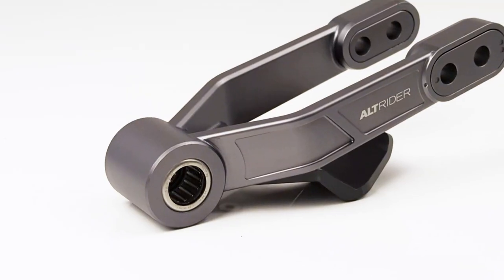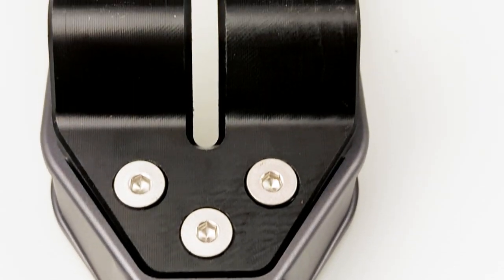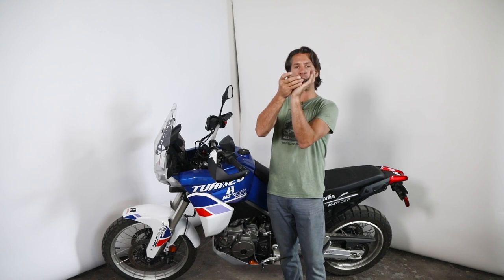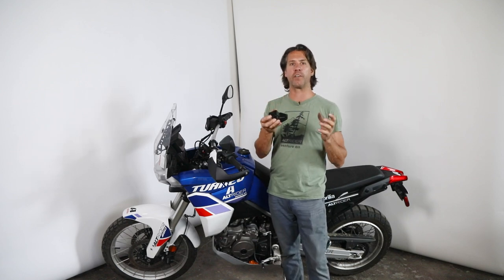The design is a solid piece of billet aluminum and has an integrated UHMW linkage guard that is lubricious — it's a very slippery plastic that will slide over obstacles, unlike aluminum guards that can snag or dig into rocks. We also put a return lip on the linkage guard, so if you have to reverse or pull back the bike, that guard is not going to get caught, which is a known problem on dirt bikes. We provide sealed needle bearings that are equal to the quality of the OEM, which is important to protect against ingress from debris.